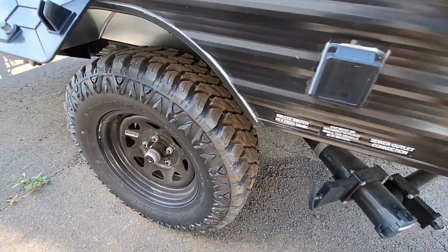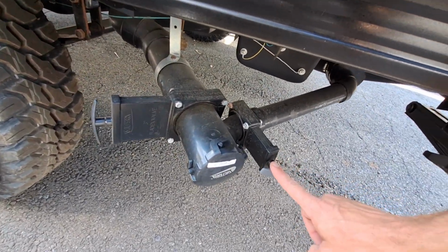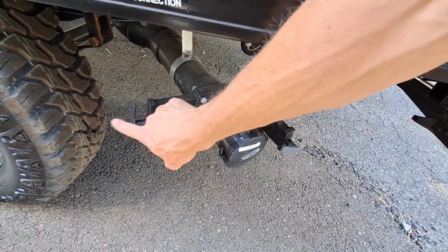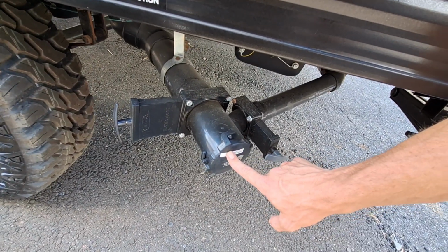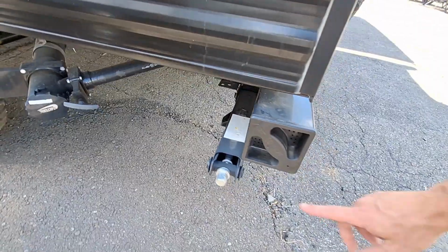These are a standard trailer. Next to that, we have our dump station. Gray is okay, black is for crap. Gray is for our drains, and black is for our toilet. Also down here in front of the tire, we have our low point drains. With this, all we have to do is buy a sewer hose, connect it there, and then open our valve gates.